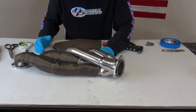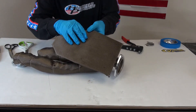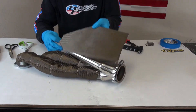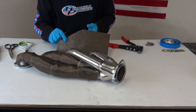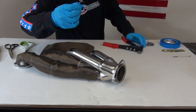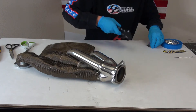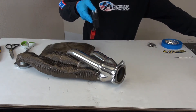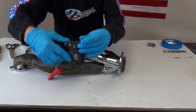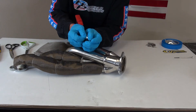Here's a quick tip for the HP Power Anchors. The first thing you want to do is locate your anchor points. I'm going to put two in the back, two in the middle, and then one up here in the front. So first I'm going to poke some holes in here. What I like to do with the rivet and the washer is get that in there ahead of time — it's a little easier. I put my rivet in the rivet gun, get my washer, and just push this right over it — just like that.